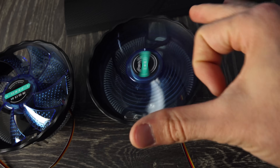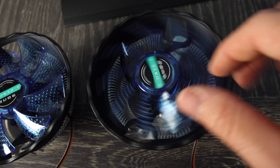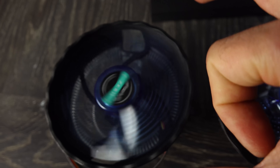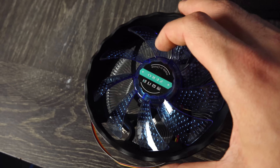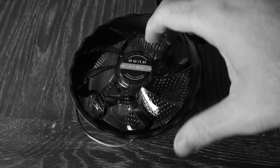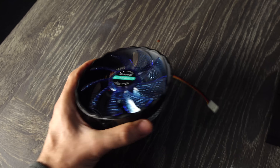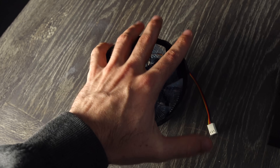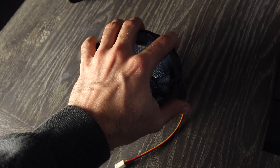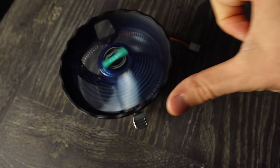However, all is not perfect with the $3 cooler. There's a normal one that works absolutely fine, but on this one the fan blade is not only slowing down quickly, it's also making a really obnoxious noise. If you do get that noise, there's an easy way to fix it — what I call the Tech Yes Man Grip: just grab it and give it a little bit of a flex all ways. And that sorts it right out.